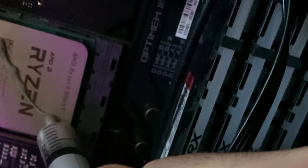Now slotting the Ryzen 9 3900XT into this build. Doing it with the board floating, which isn't ideal, but it slots in. Now slapping the cooler on top. I'm applying paste with one hand while the PC is standing upright, which makes it especially difficult, but doing a nice cross pattern without throwing paste all over the motherboard. Think we did it decently. Then placing the cooler and installing it with two hands.